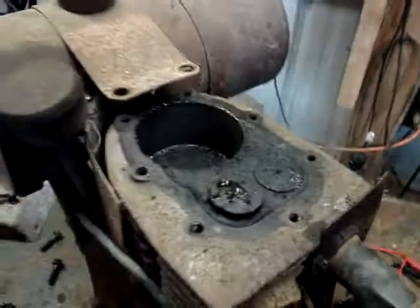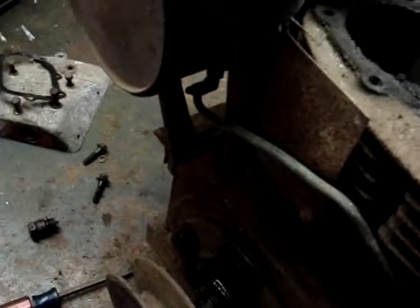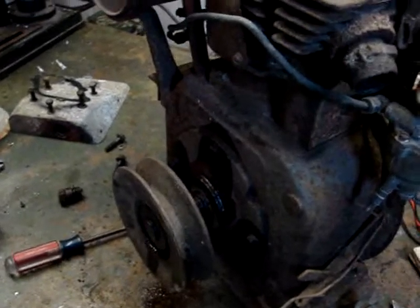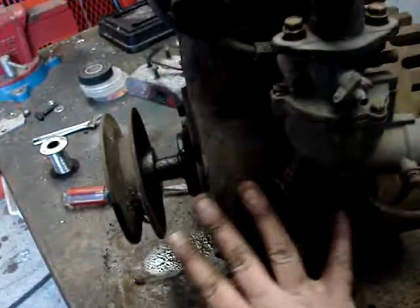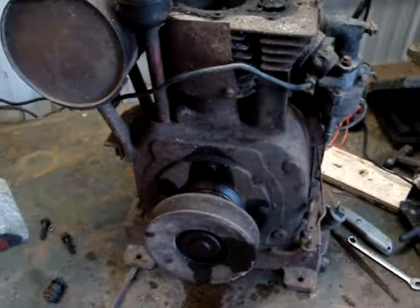Look at how small that piston is. I wonder what the stroke is on this thing. About 4 inches? What it looks like. No, about 3 1/4 stroke. And that's about a 3-inch bore. 5 horse. I wonder why the thing is so tall. I guess we'll find out tomorrow when we pull the side apart. See what's in there. It's real narrow though. I mean, that's my hand span. It's a very narrow block, but it's very tall. Huh. Oh well. We'll pull that apart tomorrow and see what we got. So tune in for the next video.